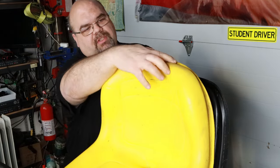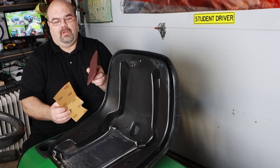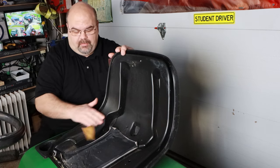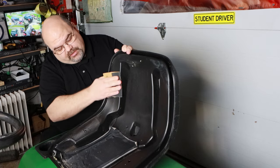I've already cleaned this one up, but do the same thing on the seat around here — just wipe that down so the edge around the outside is extremely clean. Another step you need to make sure you take is take rough sandpaper. This is 220 grit sandpaper or like an emery cloth or Brillo pad. Make sure that you scuff up this plastic as best you can, and that will allow the glue to adhere much better to the surface.